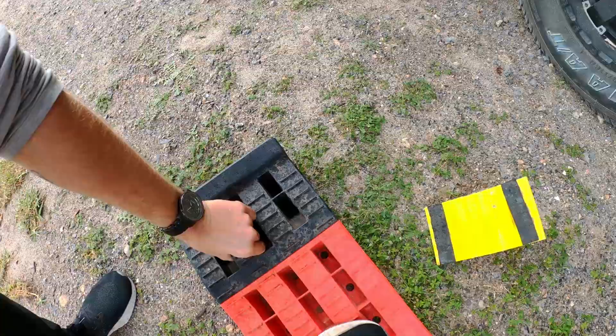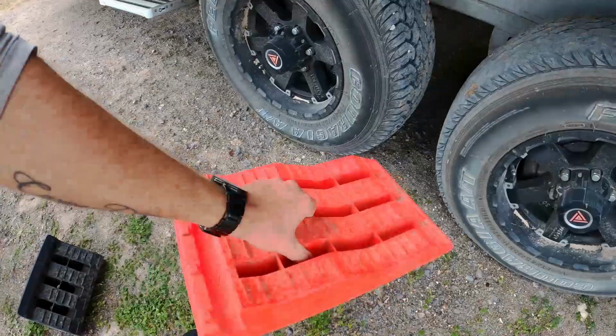So when you've got a tandem axle van, this is something we didn't know before we set off. It's best to get these split wheel ramps. Try and do that one-handed, because this then can fit between the two tires like so. It doesn't really matter if you drive forwards or backwards onto them, we found. It just depends on the situation, how much room we've got.